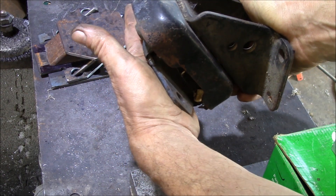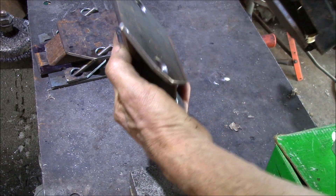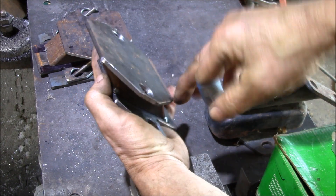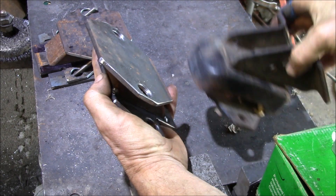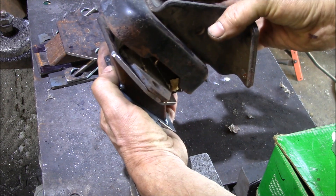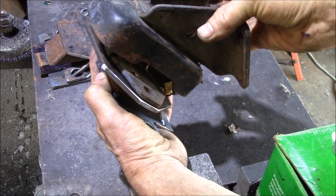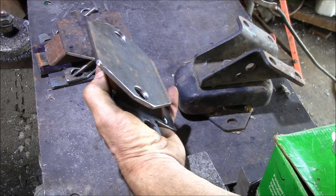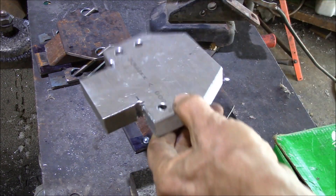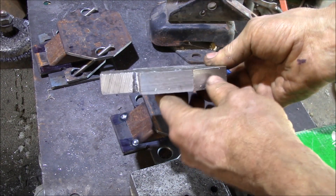Normally you set the motor down, run two bolts through, and that holds your engine in place. What we do is make these spacers — the frame bracket is here, the motor would have mounted down here, but this spacer raises the whole engine up two inches and allows you to bolt the motor mount two inches higher, raising your entire engine up.